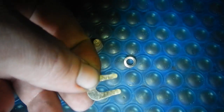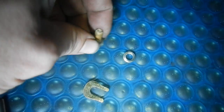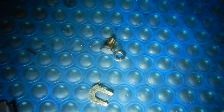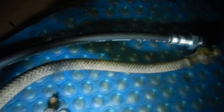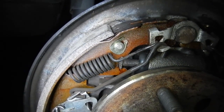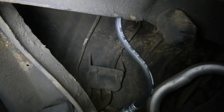I've got a new one of these little clips today to hold the handbrake lever into the shoe - the other one was crap. Whoever did the brakes last didn't put the spring washer on the bolt for the wheel cylinder, so it was all loose, and they didn't tighten the other bolts - the thing was just flapping around. Simple fix: just put a spring washer there. Also, we've got the brake hose remade. There's the new clip in place - not hard to come by them. There's the nice new brake hose fitted up, so it should be much more reliable than the old crusty one.